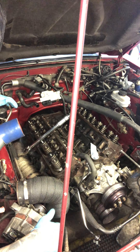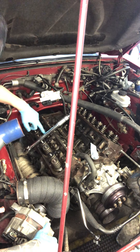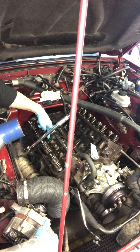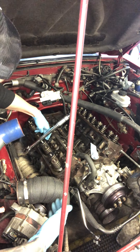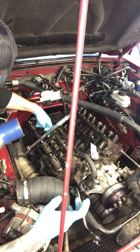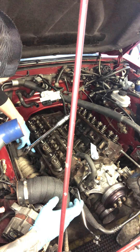The pattern on these Mustang 302 head bolts is going to be your center top — that's going to be the first one that you want to torque. I started at 50, so we're actually starting at 50 with this specific setting. Make sure you have a torque wrench, digital torque wrench, whatever you can afford. You're going to start here at 50, then 50 as well.